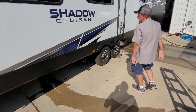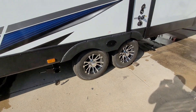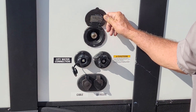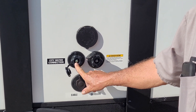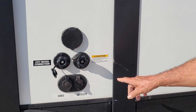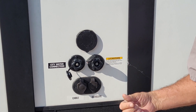The first termination valve is for the kitchen sink water only. There is a port spray hose in the trailer that connects to this like an air hose does — it gives you cold water on this side of the trailer. Then you have your city water connect that you can hook to with a water hose and regulator. And then you have your black tank flush for when you are dumping your black tank. You can hook a water hose and regulator to that, turn water pressure on to it. It has a little aerator that spins around and helps clean out more of the nasty debris out of the toilet.